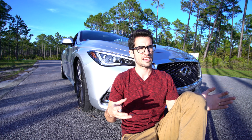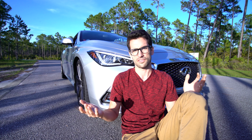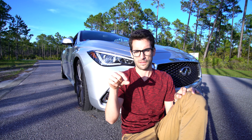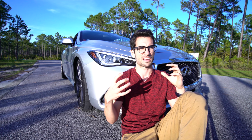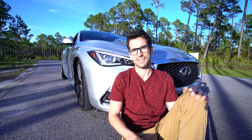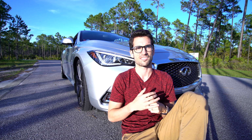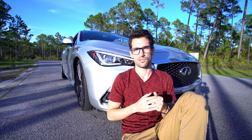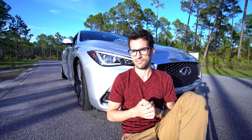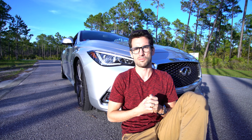It definitely gives it that JDM kind of ricey sound. It's not going to be for everybody. Honestly, I didn't do it for the sound at all. There are some little nozzles you could put in these blow-off valves to make the ejection of air sound even higher pitched. I'm not really into that. It's just more or less, again, to save the turbos in the long run, because Infiniti decided to ignore the fact that people would probably be boosting these cars a bit more than stock.